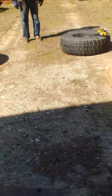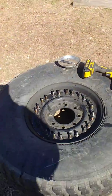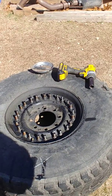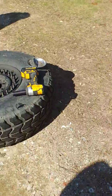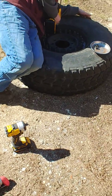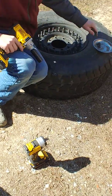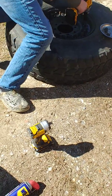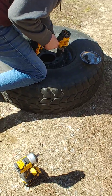On these wheels you may have to start by breaking them loose with a breaker bar if they've never been done before. You're going to want a decent impact gun - this is my smaller gun. The smallest half-inch Dewalt 20V Max brushless didn't really want to do it, so we're going with the medium-sized gun.